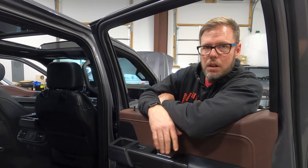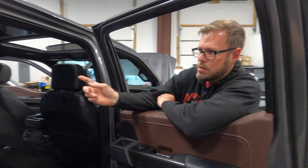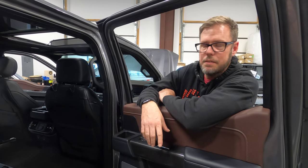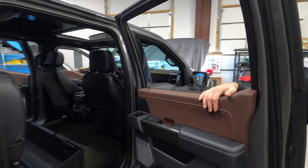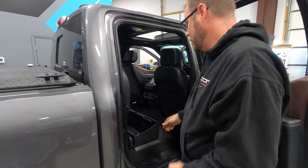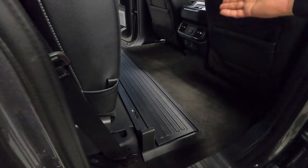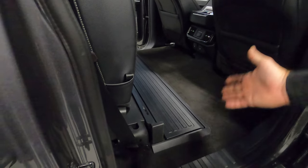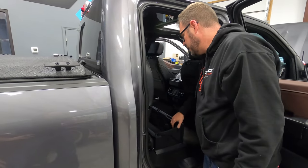It's about 880 watts of power RMS, full DSP tuned by us here in-house. It's designed to be 100% plug and play — all you have to do is mount everything in the vehicle and run power and ground to the battery, and everything else plugs in. The craziest thing is this truck actually has a subwoofer in it, but you can't see the subwoofer. A lot of people have been asking: 'I got this F-150 and I want to use my truck — I don't want to take up any space, I want to use all the space available.' So we did that exactly. We have the factory storage tray underneath.